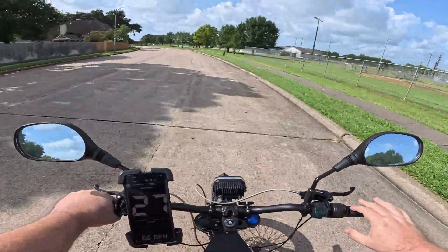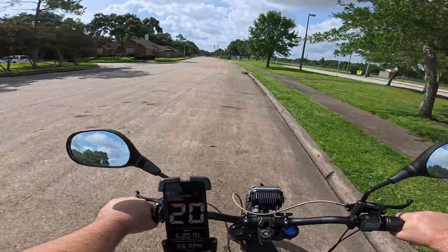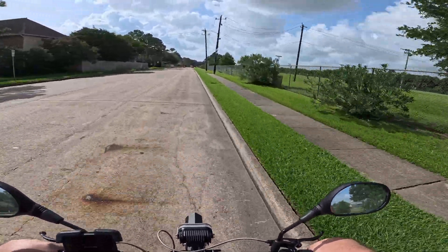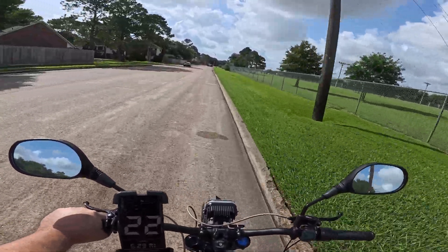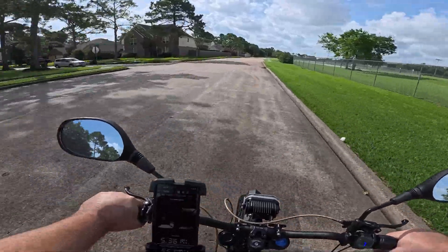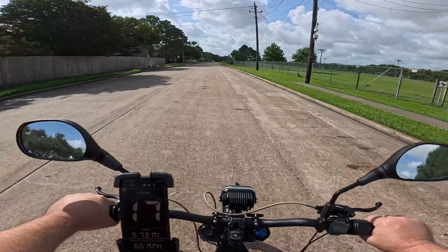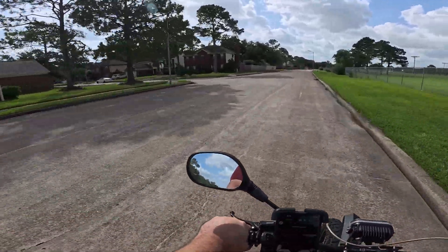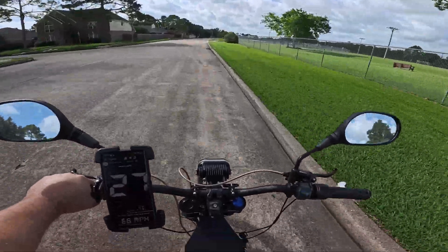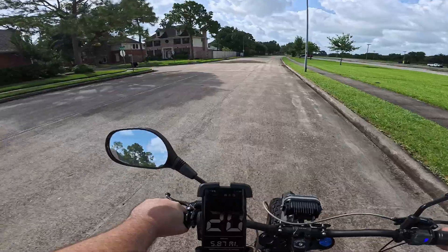I'm going to call that a success. I've been hitting it hard — it's about 80% charge and I'm going full throttle with all the throttle settings on sporty and twitchy. The BMS is not cutting in. I know the battery cells are capable of handling what I have it set at, I know the controller is, and I know the motor is — so I should be solid at this power level. No thermal issues anticipated because everything is within spec, not over-tuned. Anyway guys, that's going to do it for this one. Don't forget to subscribe, like, and comment. Next video on this one will be adding a three-mode switch and a display, and then I'll be listing this bike for sale in Houston.